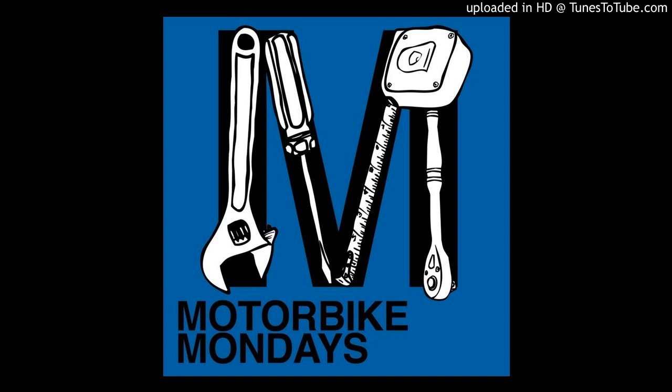I usually write down a little grid — 'E' for exhaust and 'I' for intake across one through four cylinders, or however many you have. Some bikes have two intake valves per cylinder in a four-valve-per-cylinder system; some Yamahas even used a five-valve system on many of their '80s bikes. Make sure the measurement is per valve per cylinder. You can also find pre-made valve clearance charts online to print out.